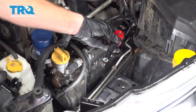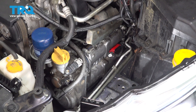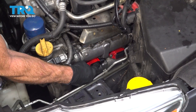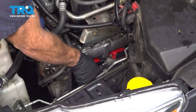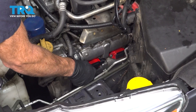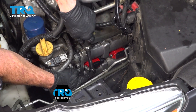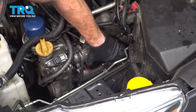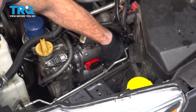Now it's time to install our ignition coil. When installing your ignition coil, add some dielectric lubricant to the very end on the boot area that slides over your spark plug. We'll slide this into position, aligning our mounting bolt port. That should slide right in. We'll continue on with our mounting bolt, and I'm going to be torquing that mounting bolt to 60 inch pounds. Now we're looking for our electrical connector — we're going to line this up and press it right on there. There's our audible click, and a light tug confirming it's secured.